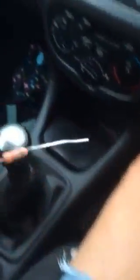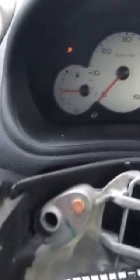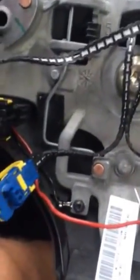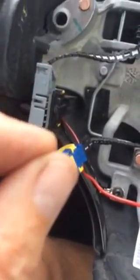My next thing is to try and con the car into thinking it's got an airbag in place. All the controller is looking at is to see around about three ohms of resistance when it checks. When I turn the ignition on it does a self-check looking for 3.3 ohms on that airbag. It will fail if it sees no resistance — a break in the wire — and it'll also give you an alarm if it sees a short circuit.